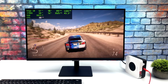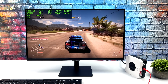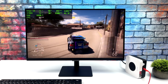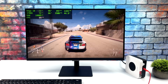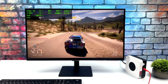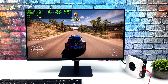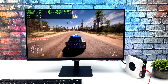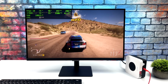This machine does have more potential than it's putting out in its stock form factor, but given the limited amount of RAM and RAM speed for the built-in iGPU, it's not working at its full potential — plus the wattage issue on that APU. So I added 16 gigabytes of DDR4 running in dual channel at 3200 MHz and set the APU to 45 watts. Here's Forza Horizon 5 — couldn't play it with the stock 8 gigs as it was maxing out RAM. At 720p low, we can get an average of 68 fps, which isn't bad for a mini PC. Since I'm running at 45-50 watts, I pulled the bottom off the unit and set it on its side, as at 45 watts it can thermal throttle sitting flat on the desk.